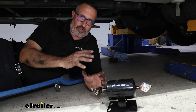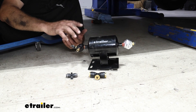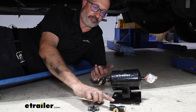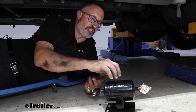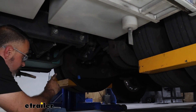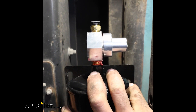The other half of the Air Force One system is on the coach side. We'll install the air tank and run lines to the back to tie into the Chevy. This requires tapping into the coach's air lines — both the supply line and the emergency line. We'll have quick connect fittings in 5/8-inch and 3/8-inch sizes. This is a Freightliner chassis and all the tank work and valve tapping is done just in front of the drive axle, near the back of the axle where you have the brake chambers on either side.